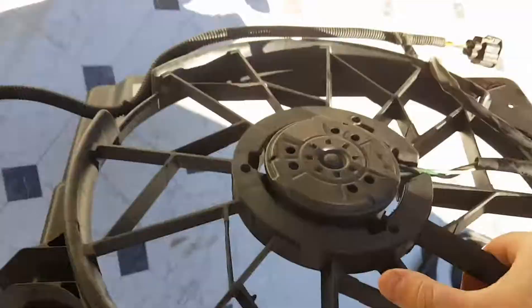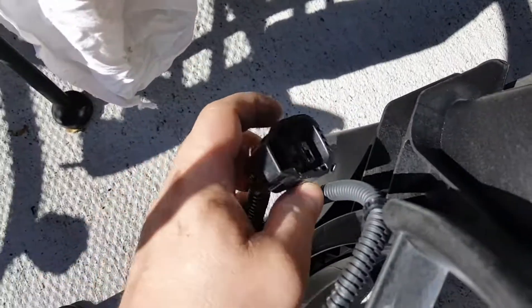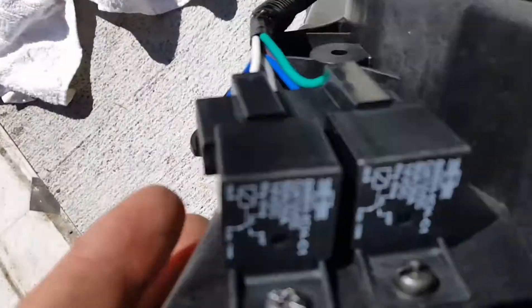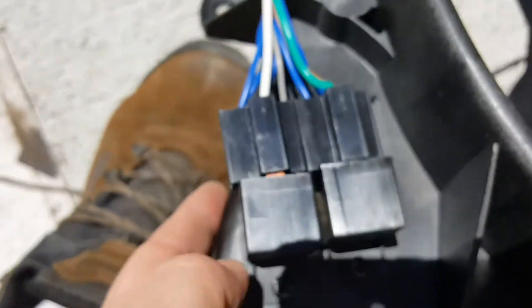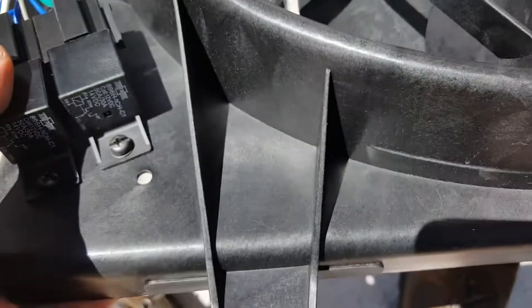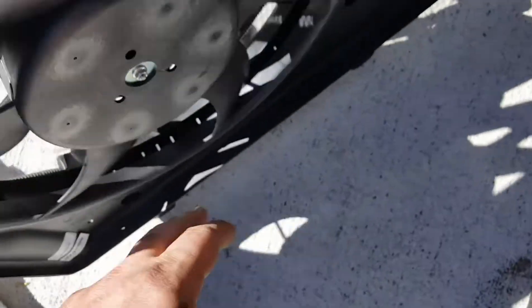So you have these two cables here. This fan is a little more organized over here — the new one. Put these side by side: this is your bottom plug, this is what the plug looks like that goes into those four prongs. That's that little relay thing there, and they've actually got these bolted to the fan, which is nice. I will show you one thing — I'm going to tighten that screw because it's a little loose, that's just the way it came, but that's not the way I want it. So you've got that plug down there — that's really the only one you need to plug in. This is already plugged in, and you want to make sure the new fan spins.